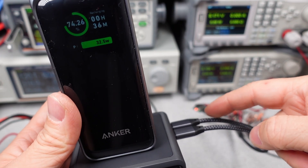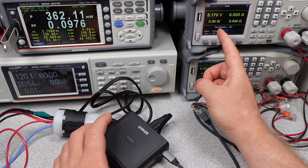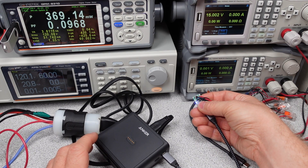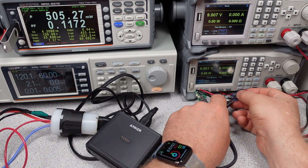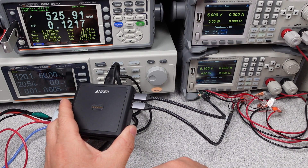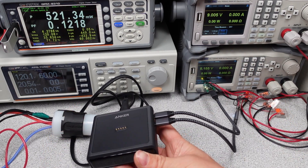The idle power settled out to a higher number — not the worst, but certainly higher than normal. It meets the requirements for a multi-voltage device for DOE, but not for a single voltage device. For modes of operation, this adapter has 5, 9, 12, 15, and 20 volt fixed USB 3.1 power delivery modes, plus a programmable power supply mode at 11 volts that can do 4.5 amps — so it's borderline for supporting 45 watt Samsung super fast charging, and it may struggle since the current limit is set a little too low. The power sharing is different on this one: it renegotiates on plug and unplug, but it is so fast on the unplugs that the meter doesn't register a change if only in 5 volt mode.